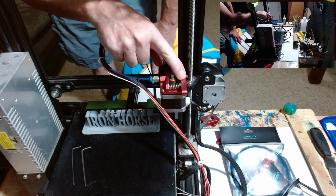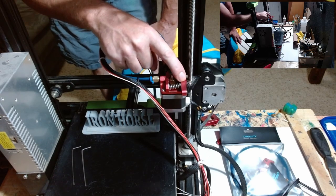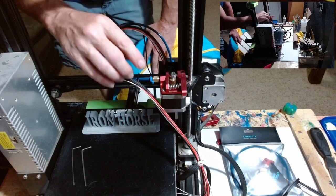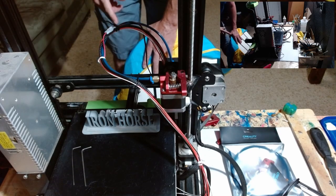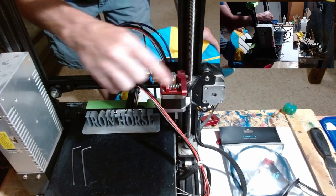If you have a plastic one, it probably cracked right in here and you might not even realize it. So if you're having problems printing right now and you think it might be your extruder, come look right here and see if you got a crack. If you got a crack, I want to encourage you to subscribe to my channel. Haha. All right, so let's get this off.